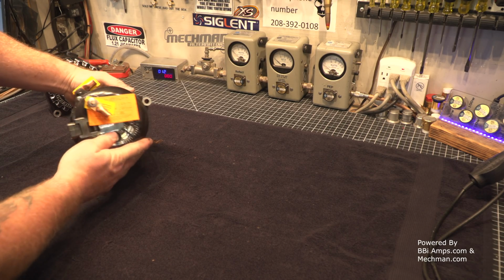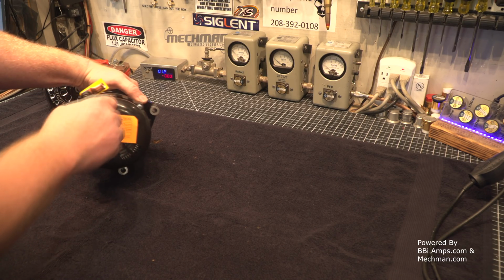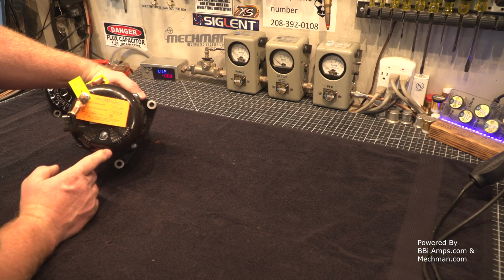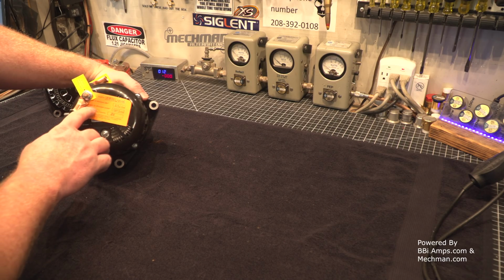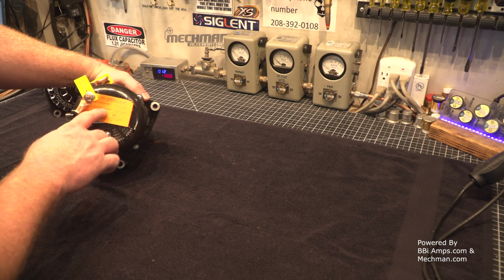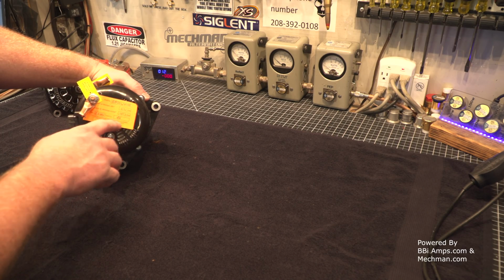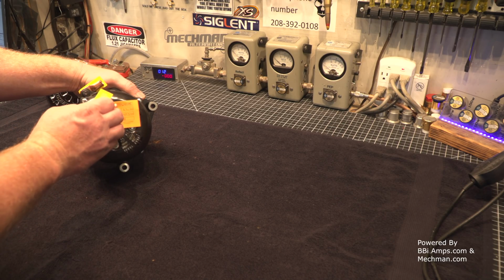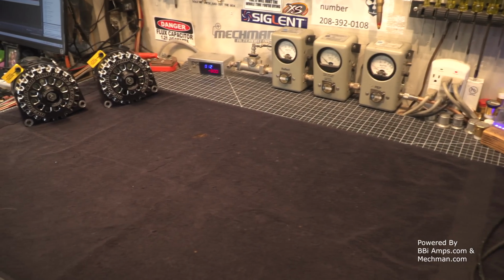Now on the back of each alternator, there's going to be a birth certificate. This is telling us output at 800 RPM idle, 221 amps, output at 1800 RPM cruise, 407. The date it was tested and who it was tested by. So we're going to see. Because you guys know me, I like to break things. I like to burn things. And I love to set things on fire.